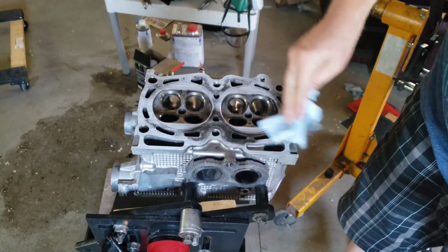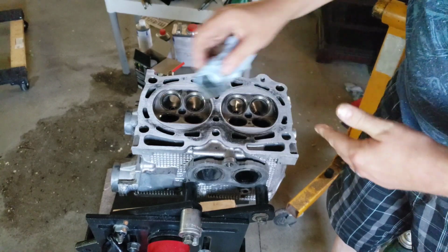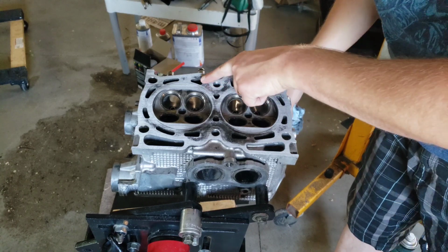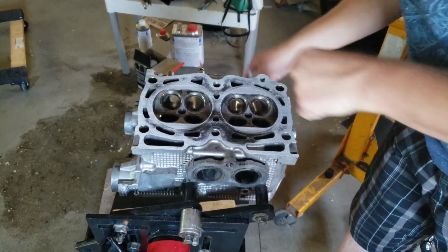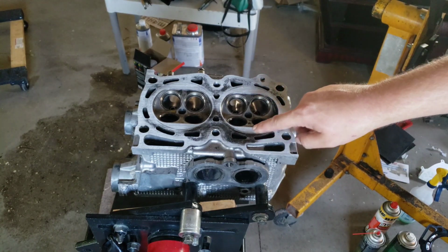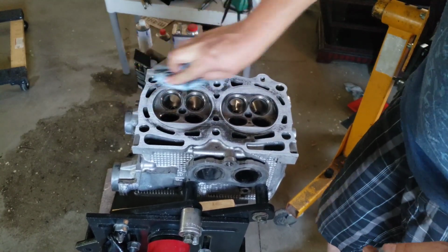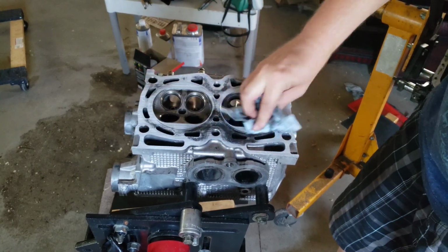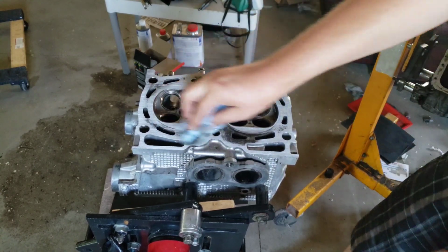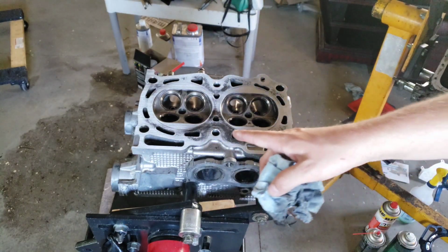And already, you're starting to see a difference. These black parts that used to be around the edge are starting to go away. And we're going to start to see it looking like this all the way around. Now, these are lower spots that need to be machined more. And once you have a nice shiny surface on there, you will switch to the next grit of sandpaper. So I'm going to continue on until this is shiny here.